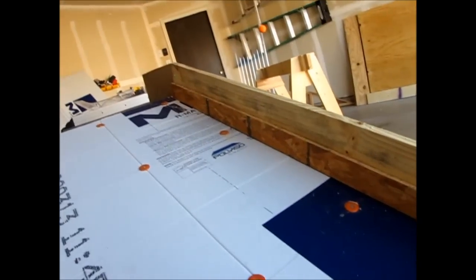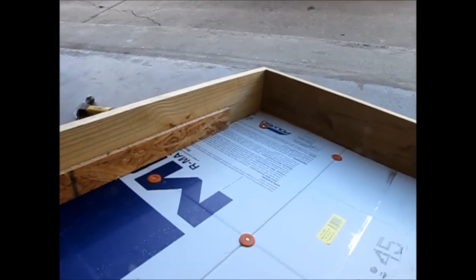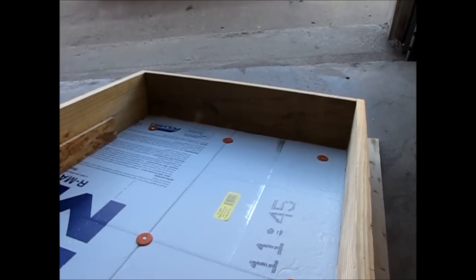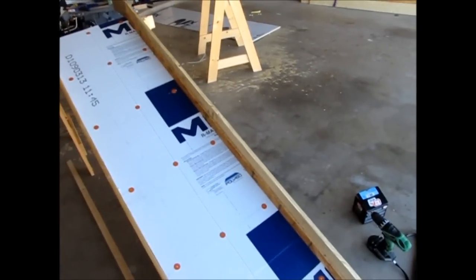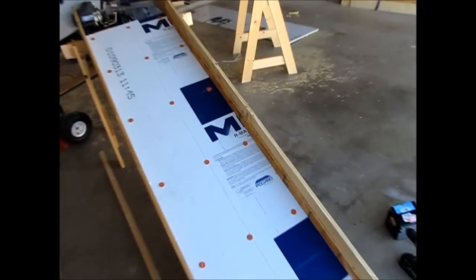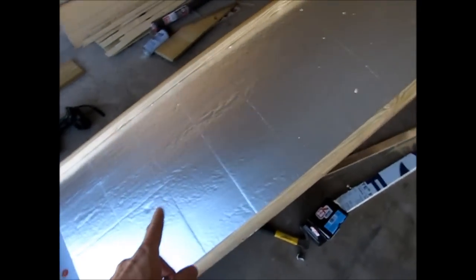Those strips will be the support for the shelf that goes over the top, dividing the cold side on the bottom from the hot side on the top. I've cut this piece six inches short of the bottom — that open space is where the cold air falls and collects, and the warm portion at the top draws from it, kind of like a plenum. The rail is now attached from the outside so it's easier to take apart for future repairs. The shelf is cut from poly iso to fit.